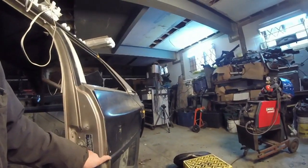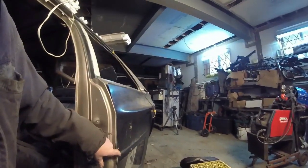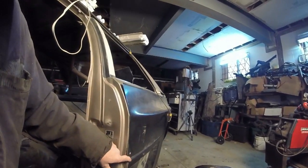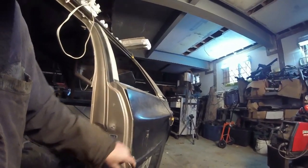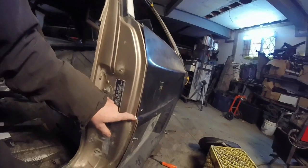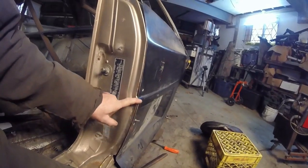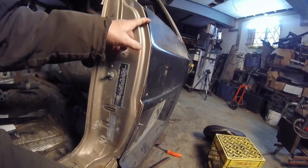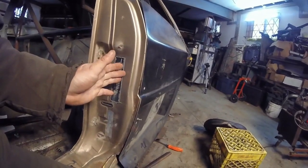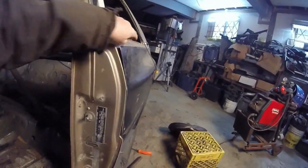But we have to sit there and figure out where this fender flare, or how far out here I can actually put this steel and bond it or mate it, but not have it look terrible with the fender flare. And the thing is, it starts to flare right out. This is going to have to be moved up into this line, and they'll be together. And see, this is heavier set than this. And this is going to mate fairly well with just a straight overlap or underlapping patch or tabs.